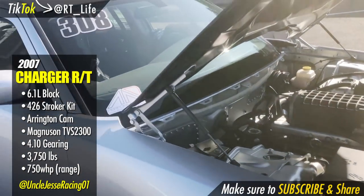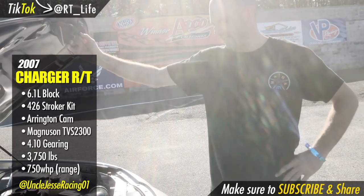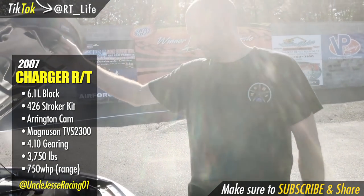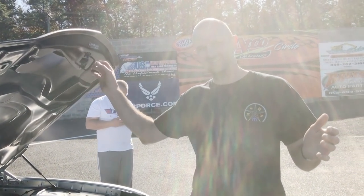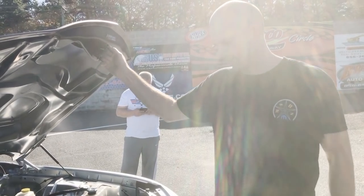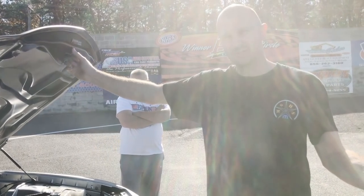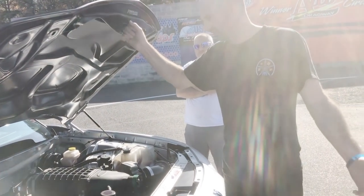And what do you think you're putting down to the ground? We tried to dyno it, but with the 410 gears, we just kept blowing tires off on the dyno. Okay. Yeah, you aren't getting accurate readings. If you do those calculator types, weight of the car, what you run and stuff, I'd have to do it with what I just ran. It says I should be like 700-800 at the wheel. I don't know. I'm skeptical of it. No, that sounds pretty accurate.